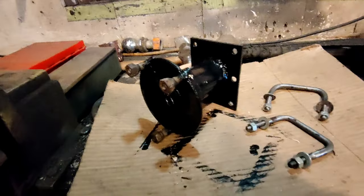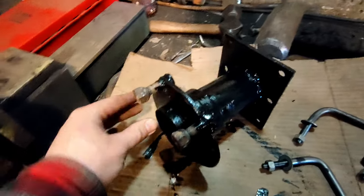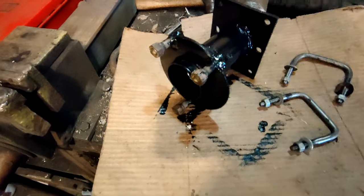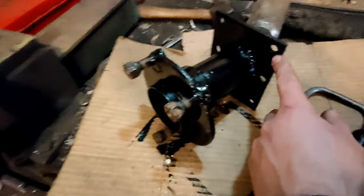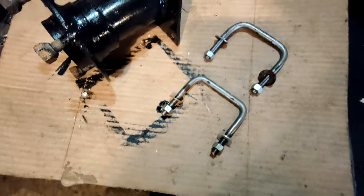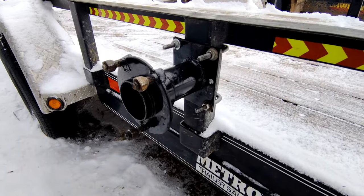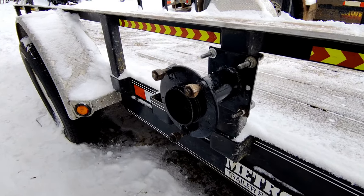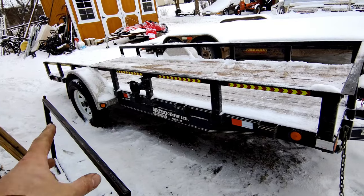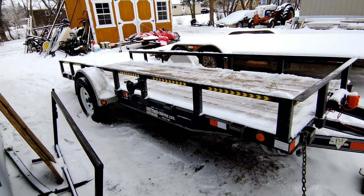Okay guys, got the spare tire holder all done. Just used a hub - cut out two of them and welded them in. There are only three mounts or three bolts for the tire. Back here there are multiple adjustments on this steel bracket - it comes out five inches and I made some brackets to bolt it onto my little trailer. Got the spare tire holder bolted onto the side of the trailer - that's going to go on the passenger side, because that's the safer side to have it when you have to take it out on the side of the highway.